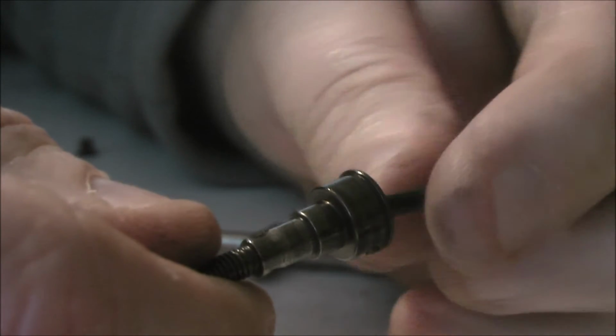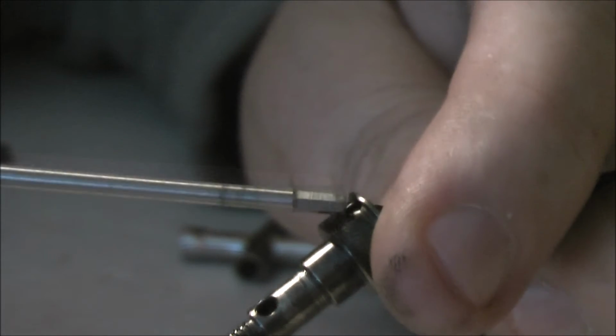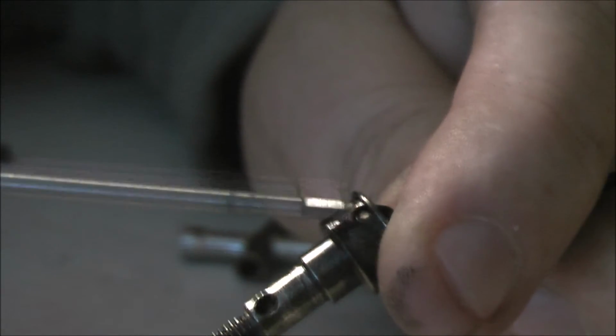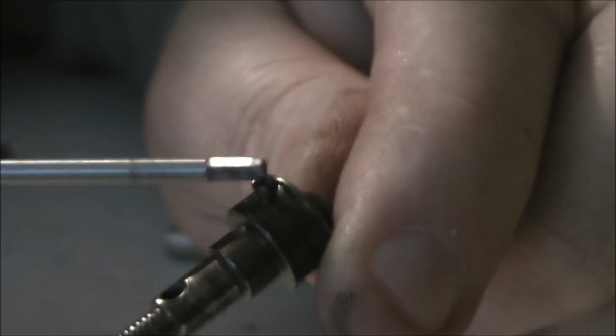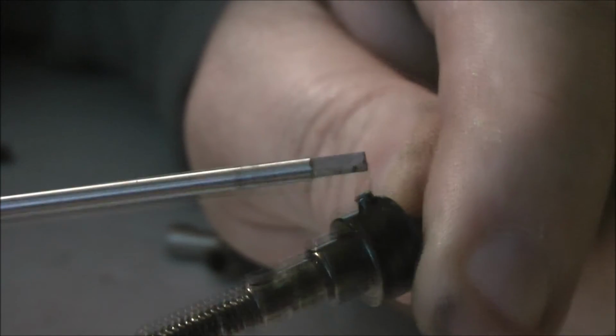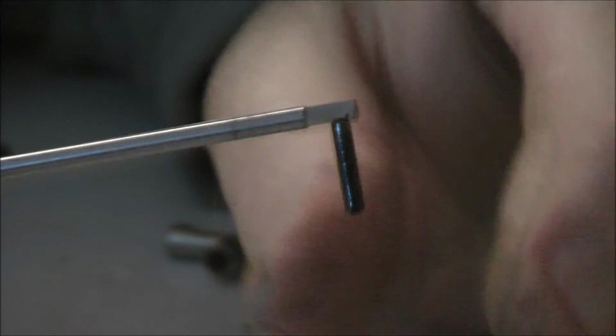And one side of this drive shaft, where that pin goes through, just there, is smaller than that side. So the pin goes through, but it won't drop all the way out. But also what happens is, if you get a magnetic screwdriver and take the tension, the pin will just slide out just like that. Okay, which is what's happened on the old one.